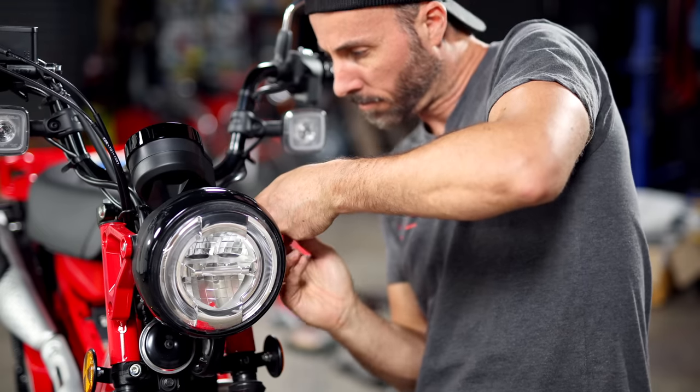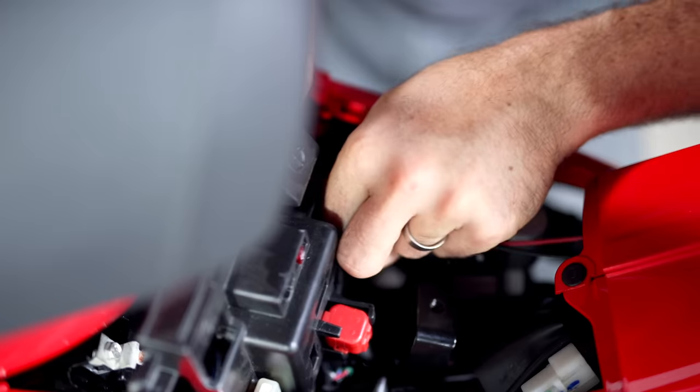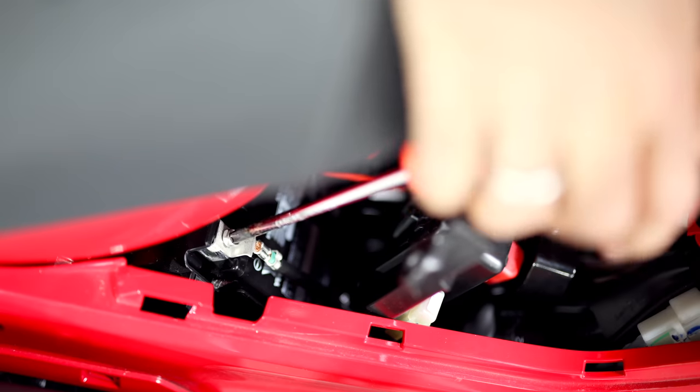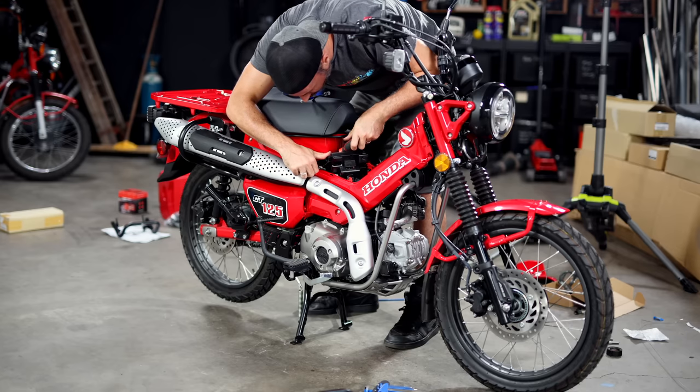Anyone who's modified cars before will know that it's just the same — you see these wild sponsored cars on Instagram and then everyone wants to copy the style without actually thinking about the reality of having to live with, own and drive a car that may not be at all suited to what you need. So my dual port USB socket has been installed, and there are a couple of different strategies when it comes to how to actually wire these in. One of those is of course having switched power, which means that when the bike is on there's power running through, but when the bike is off the power is off. That's good because it saves your battery and you can't accidentally run it flat, but the downside is that you can't be charging phones or devices at camp while your bike's not running.